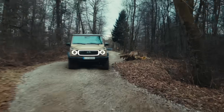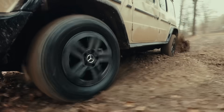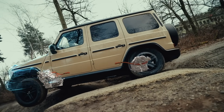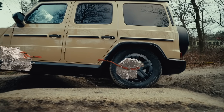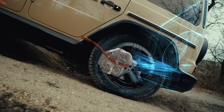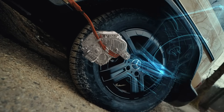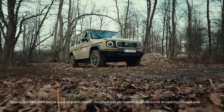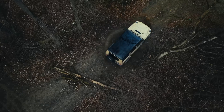The advanced drive concept in the all-new electric G-Class is based on four individually controlled electric motors mounted close to the wheels. The motors are mounted to the ladder frame and come in double packs — two in the housing at the front axle and two at the rear axle. This arrangement ensures torque is delivered whenever and wherever it's required. The electric drivetrain also enables numerous new features exclusive to the all-new electric G-Class, including the G-Turn and G-Steering.